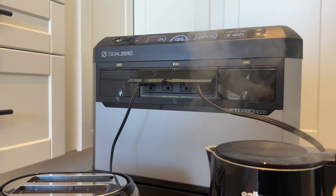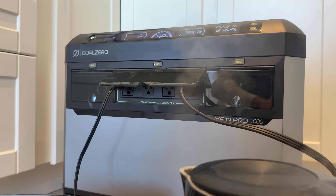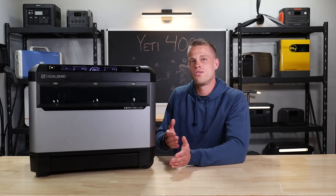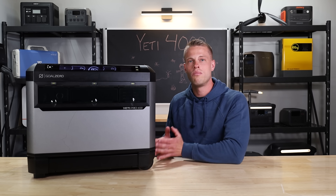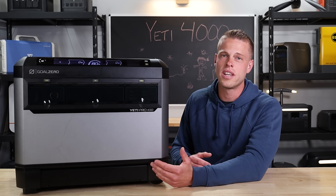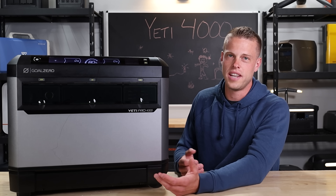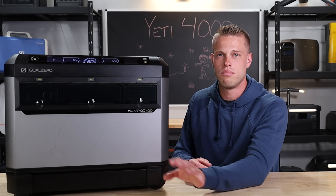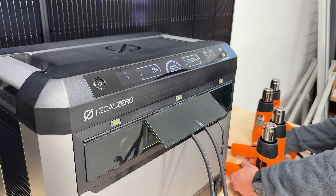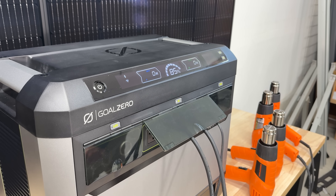The other thing we don't really like is that it has a 3,600 watt inverter but the AC charge rate is only 1,800 watts. So the UPS doesn't allow you to continue charging the unit if you're drawing more than what you can supply. In the case of other units, you could be running a 3,000 watt load and it will still take a charge of what it'll allow out of your wall outlet at 1,800 watts — sneak it in, bypass it through to the battery. This unit won't allow you to do that. As soon as you start drawing beyond that 1,800 watts, it cuts the charging rate completely off.